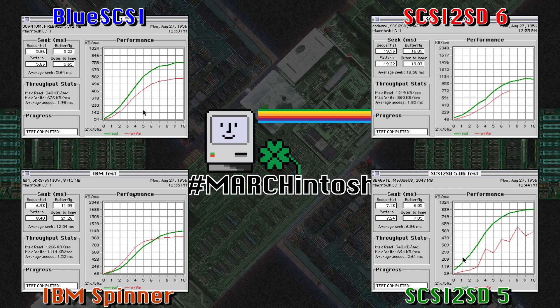Looking at all the benchmark tests, let's see if we can find who the winners and losers are. The overall winner, I think, is actually the IBM drive — its maximum read and write speeds basically blow everything else out of the water. It does a really good job at max throughput. Of course, it has some seek problems because it is a good old-fashioned hard drive and it takes forever to move the head around, so its average seek time is going to be a lot longer.